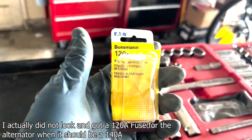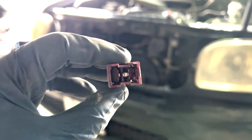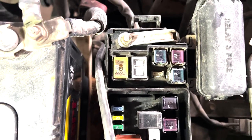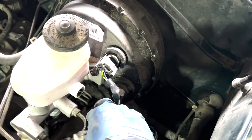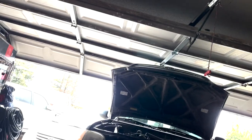Here's what I went with — old one right here. I definitely did not check this alternator fuse; I did not think of it. It would make sense why it would have blown. This is the new one right here, the white one. I'll plug these guys back in and start it up again right now.